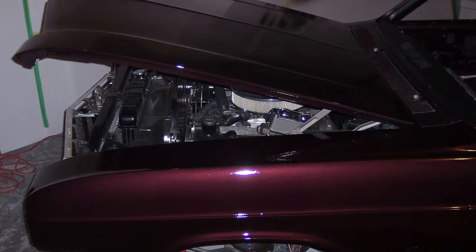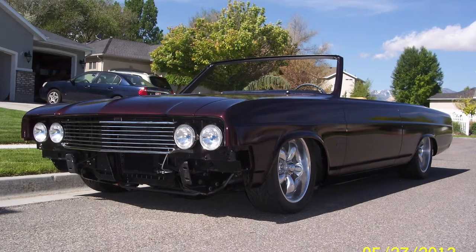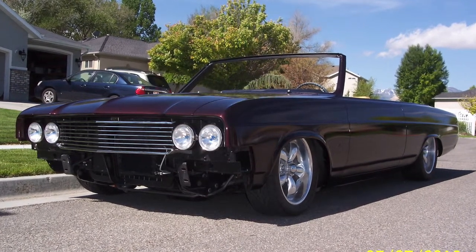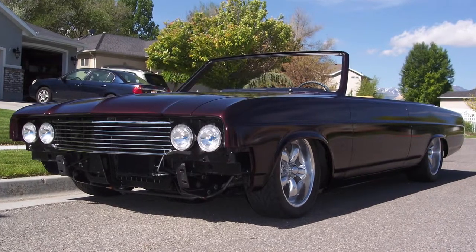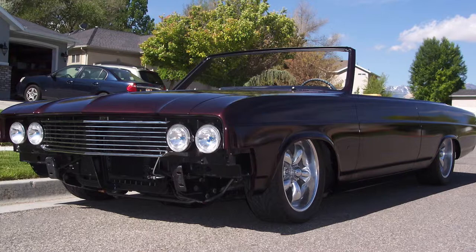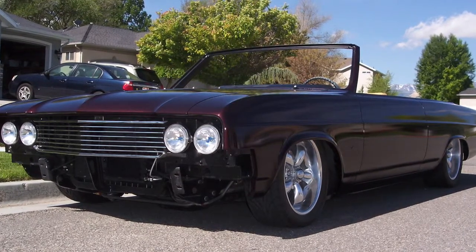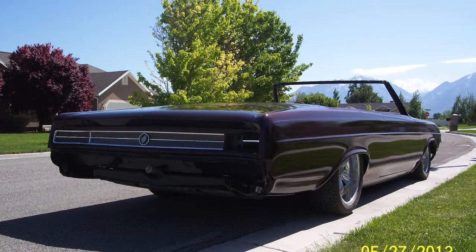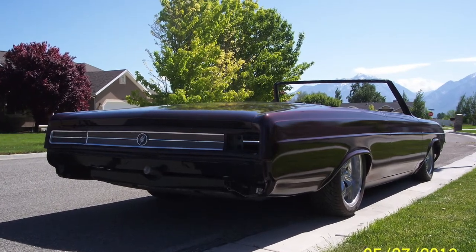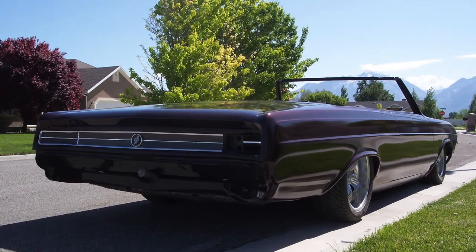That gave it a real dark, gradual color change — the Foose fade. I let the paint cure for a good 24 hours before I unmasked it, peeled off all the masking, cleaned everything up, pulled it out into the sun, and let it bake really good. Then it was time to start putting a few things back on the car, and once I was comfortable I had a solid, hard clear finish, it was time to color sand.